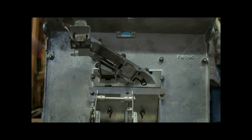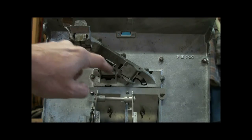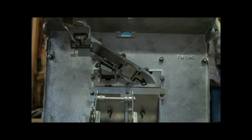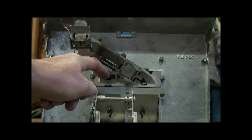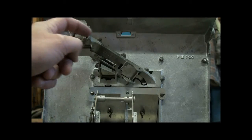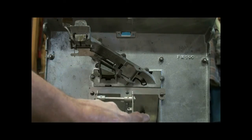The jackpots are filled by this chute, and there's a series of flaps here and here on the back side. As you play the game, a nickel falls down and starts filling up the first jackpot. Once the jackpot is completely filled up and nickels start backing up, they press against this lever, which causes this edge to fall into position so the next nickel will no longer fall past it but ride across the top and start going down to fill up the second jackpot.